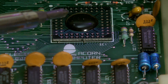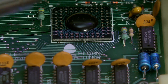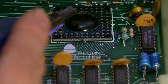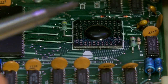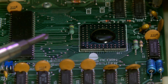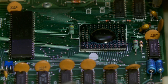That is the chip that all those different chips in the BBC Micro, the display, the sound and all sorts of other things has been integrated into. And here on the Electron, this is a later revision Electron, evidently, because it has the blob of epoxy resin on the top. The original models had a metal bar that seated the chip down that went across it. And what happened is the board heated up, the chip will get slightly pushed out of its sockets and the machine will become unreliable and crash. And Acorn fixed this by putting that blob on there to hold it down instead.